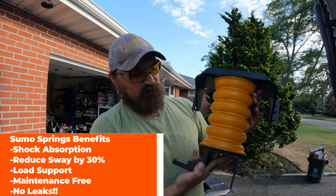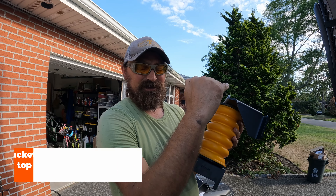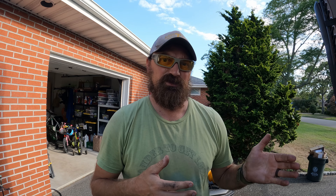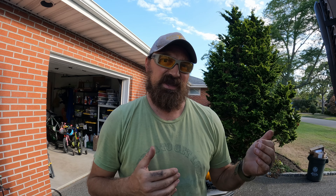If you've seen our other videos, specifically the one where we were at the Safety Plus factory, we got a whole bunch of stuff done for our steering and control of the RV. We've also decided to add sumo springs to the front and rear. The biggest thing you're going to have to do is drill into the frame of your RV to mount the bracket. This is the top bracket — it's got three holes on each side — and you'll be drilling two holes to bolt it to your frame. The sumo spring mounts underneath, and this is what the fully assembled one looks like, for the passenger side.